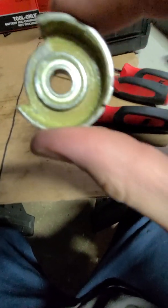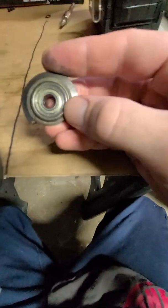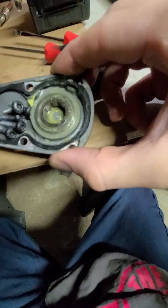Still won't focus. Sorry about that, guys. Hopefully eventually I'll have a better setup. So you want to remember exactly how all this comes apart. But again, pretty small bearing, and I imagine that thing is really spinning fast. And we already know we don't have a bearing on the top cover here. Just grease and looks like a pressed in part into a cast aluminum piece.